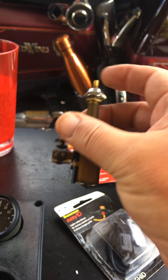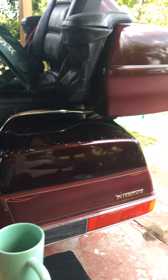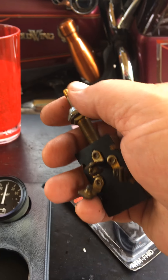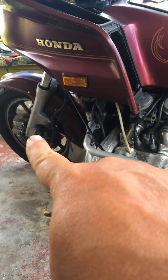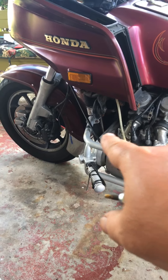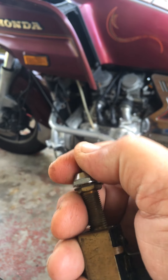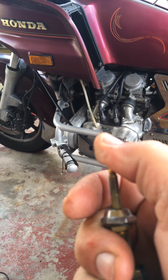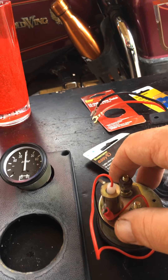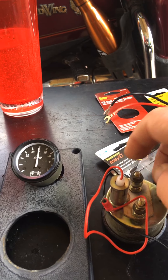There are times where I wish my phone was charging when the ignition wasn't running. I'll probably reuse this switch. I got another switch on the other side for each set of lights — I got those little lights here and fog lights here. These are rusting, so I want to de-chrome them and paint them. I'll probably just have these come on all the time with the headlight and put the fog lights on this switch, so the charger comes on and the lights come on too.